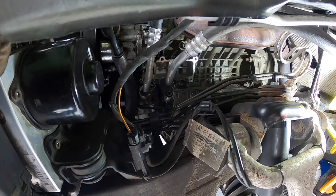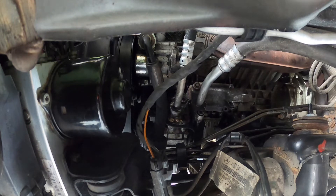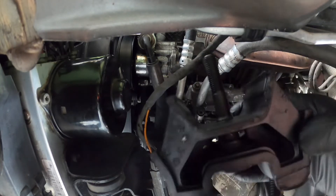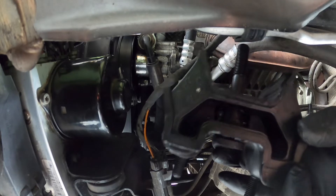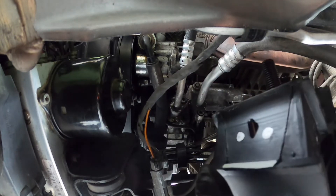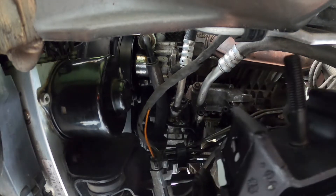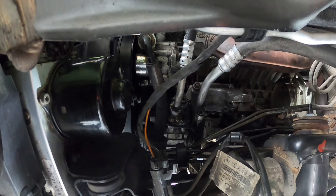I started to put the bolts back on again, but one thing I want to say: I didn't use the genuine motor mount from Mercedes-Benz. These cheaper aftermarket ones have the wrong marking — the front is on the back. The thinner side is supposed to go at the front and the thicker at the back. I had to switch it by comparing it with the old mount. If you try the mount and it doesn't line up, this is more than likely the culprit.